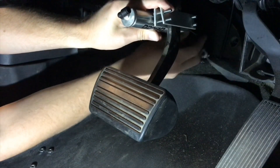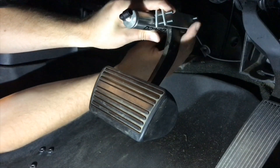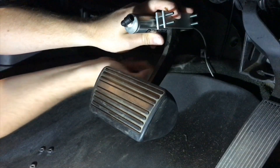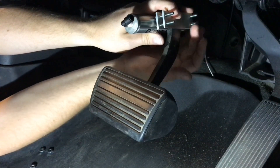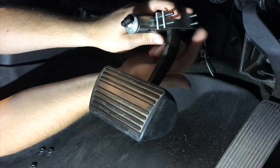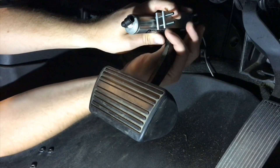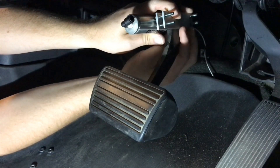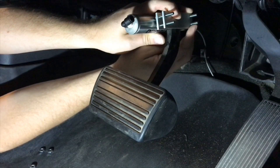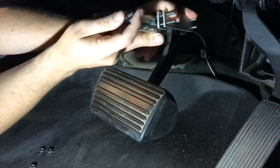What we're looking for is a quarter inch of play in our cable. Once we've found the right amount of slack, go ahead and start tightening down our four nuts on our clamp using a crisscross motion to evenly tighten it — we actually want it to bend around the brake arm, which acts like a lock nut for our nuts. Once you've got that tightened down, all that's left is to attach our air hose to the back of our air fitting.